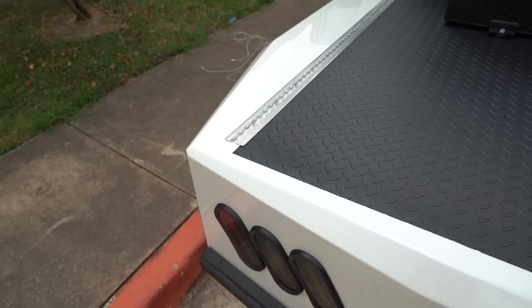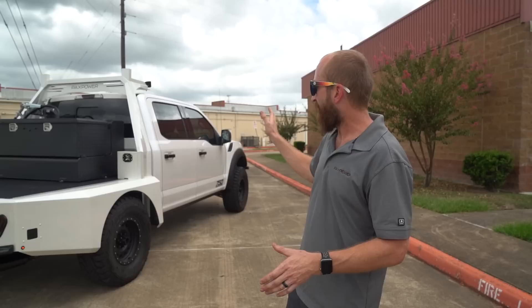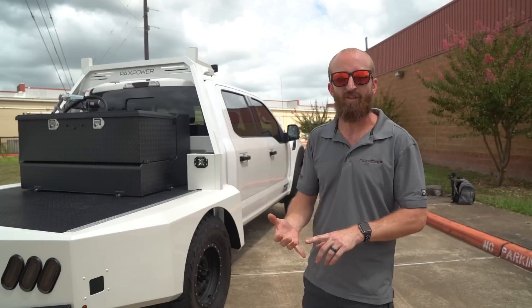You'll see that we've flared the flatbed, which is a total custom build. We built custom bodywork to mimic that of the front end and give it that flare so that it sits outside of the wider Raptor axle and widened rear track. We have a legitimate load floor here that is able to handle pallets, and you can see the Max Track system. When we originally built this it was specific for this customer, but since then we've come up with some cool uses we may offer with these flatbeds.